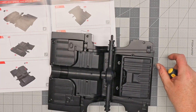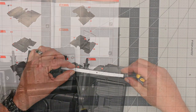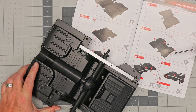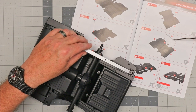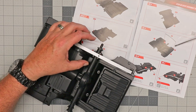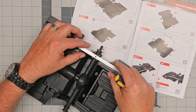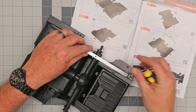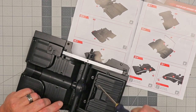Now it wants us to take the leaf spring included with this kit. I want to make sure I get this oriented the right way. The easiest way to say it: you're going to orient it this way. According to the picture, there are three metal bands that hold the leaf springs together, spaced fairly far apart, and they're supposed to go down on this end. On the other end, there are also three bands but spaced real close together — those go on the other end. You want to pay attention to that detail.